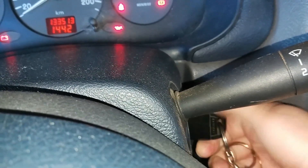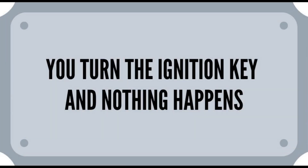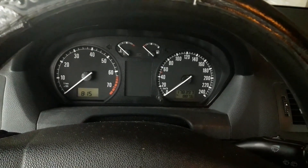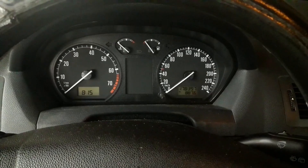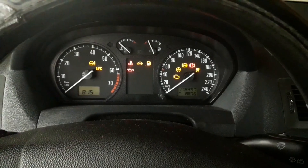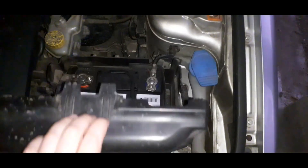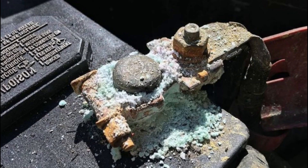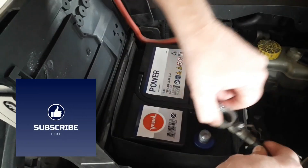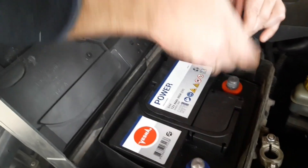We'll start with the symptoms and then offer a possible solution. So you turn the ignition key and there is absolutely nothing — it's the same as if you haven't even turned the ignition key at all. This goes also if the dashboard lights come up but when you turn to start to crank, everything dies. In this case, check these two things: the battery terminals and connections. If you see a lot of yellow and green build-up on the terminals and clamps, first try cleaning them. Use some sandpaper, a file, or just make sure that the inner parts of the terminal are shiny and clean. This is very important.